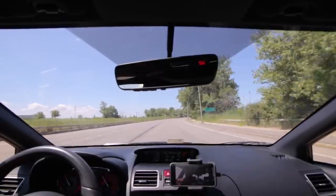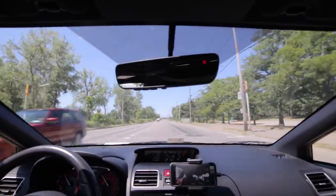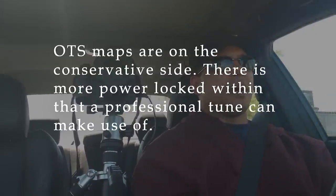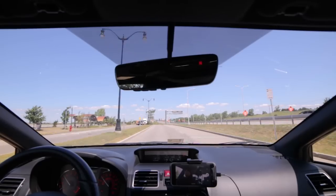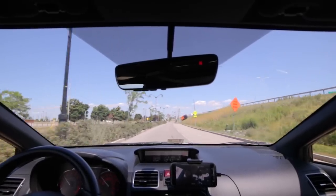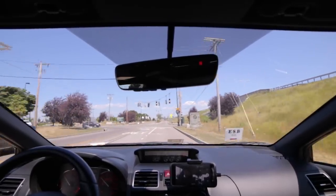This is from an off-the-shelf map. Once I get a Protune, I think it'll get even better. There's a lot of power locked up in the emissions requirements Subaru had to abide by. As far as power goes, you can't expect a massive improvement from a Stage 1 tune — it's a subtle increase across the entire RPM range. I improved my 0-60 times by maybe half a second or so, and I did that by using launch control. Cobb added their own launch control sequence where you push the cruise control button. I tried it but didn't like it — I just used the standard launch control that comes with the car, which worked fine. The car is now down to about 5.5 seconds to 60.